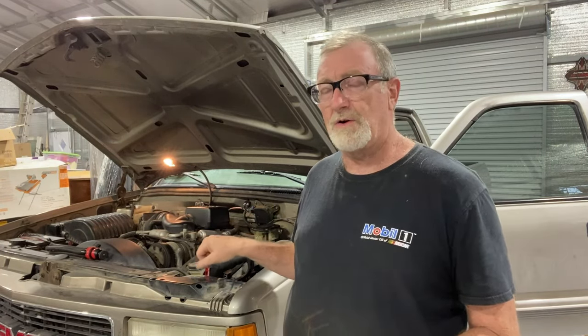Welcome back to the channel. Today I was working on the GMC and I thought I would make a quick video on this particular topic: the TCC wire. When you're doing an LS swap and swapping in an electronic transmission — 4L60E, 4L80, or whichever electronic one you're using — it needs to tap into a particular wire in your OBS system so that when the brakes are applied, it disengages the electronic torque converter. There are actually a couple of places you can put this wire.